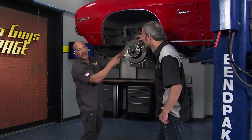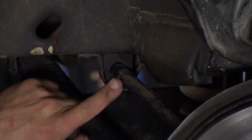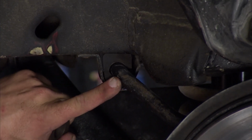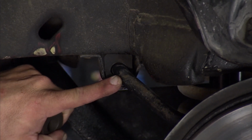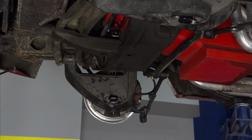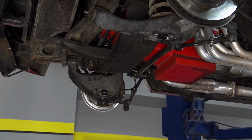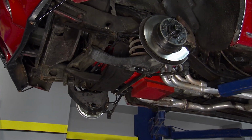Also, Kevin, you were mentioning that 5/8 inch sway bar. Look at that little thing compared to the new one. It's like a coat hanger in there. The new one's thick, beefy, really gonna help on that body roll, which we're gonna get to in a minute. So we're gonna tighten up all the mushy stuff and make it nice and firm. We're also gonna change a little bit of geometry in there and make the design better.